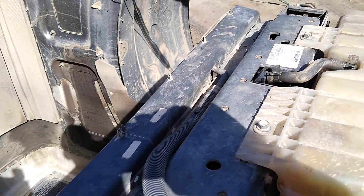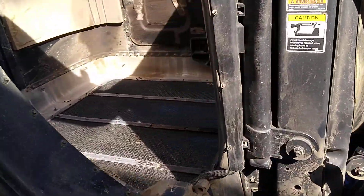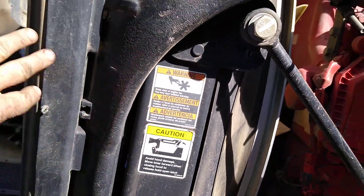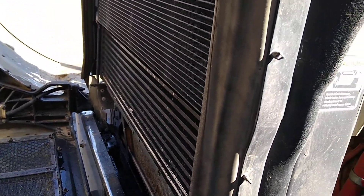Making sure nothing leaks before I can call the customer. That's what your radiator gets like — gets really bad up behind towards the center where the fan pulls the most. The best thing is to separate everything and steam it out probably once a year before summer starts.